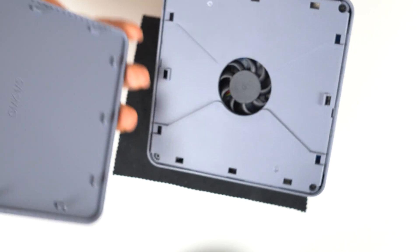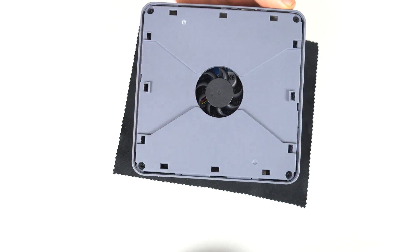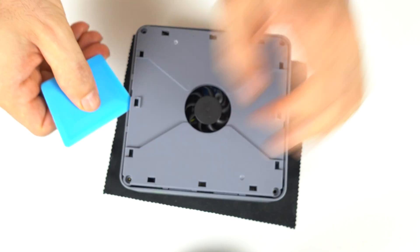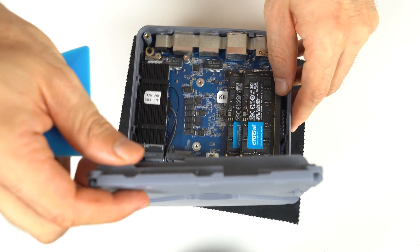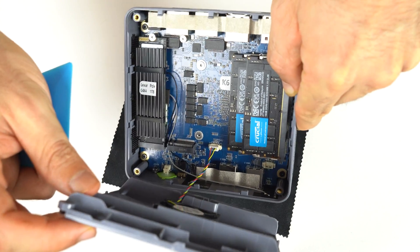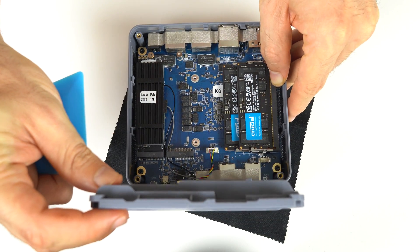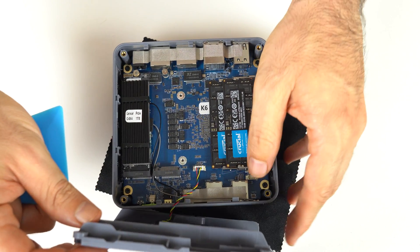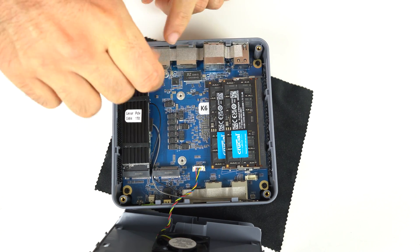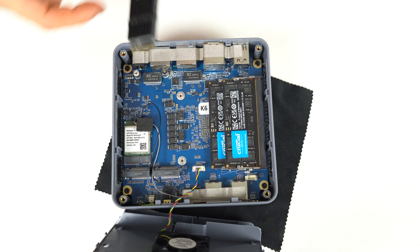Just like GMK Tech's previous minis, you can open this one pretty easily by popping off the top lid, and then there are four screws for this new part — now you know what the screwdriver is for. It also helps to use the prying tool provided to get it out; watch out for the fan cable. Previous criticism has been listened to: the memory and storage now have cooling — a fan for both, and a heatsink on the NVMe drive too. You can expand storage with an additional 2280 Gen 4 NVMe drive, and underneath the first one is the M.2 Wi-Fi 6E Bluetooth card, which is a MediaTek RZ616.